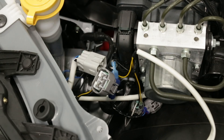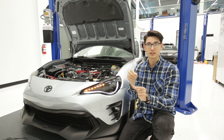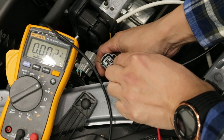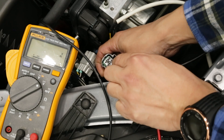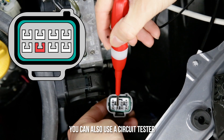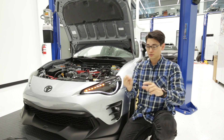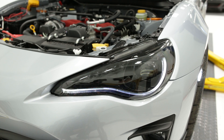This is really easy to fix if you have a multimeter. You'll disconnect the harness, then stick your multimeter's negative lead to a ground in the engine bay, which is easy to find. With the positive red lead, you're gonna tap and touch each little pin. The constant-on DRL is gonna read a steady 12 volts, and when you find the turn signal, that one's gonna be flashing. It might flash too fast for the voltmeter to show the exact voltage, but you can see it's still flashing on the multimeter. Then just use a small pin to de-pin those harnesses, switch them around, and they're fixed.